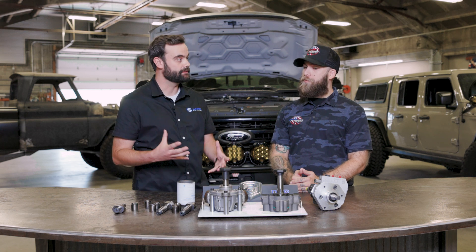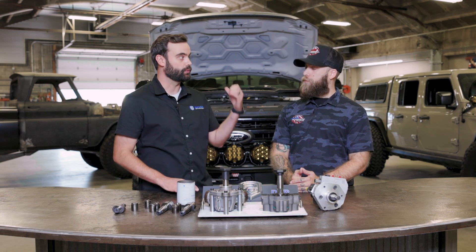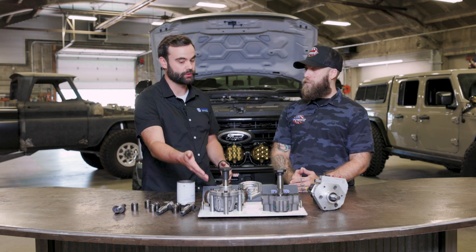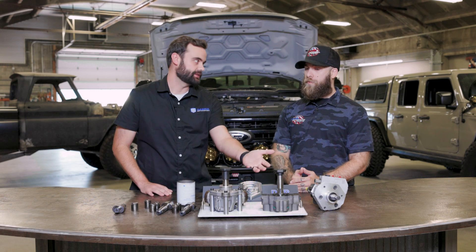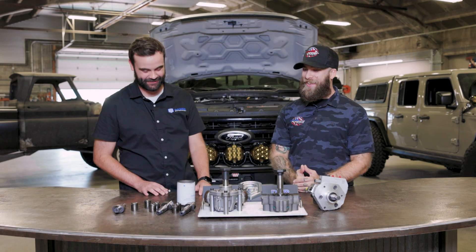The DPK was the best option we had for a long time. The reason is that a CP3 or another high pressure fuel pump will not fit in the valley of a 6.7 Power Stroke because it is so tight — there was only room for the CP4 up until the DCR. Yeah, these things are shoehorned in there. There's not a lot of space.